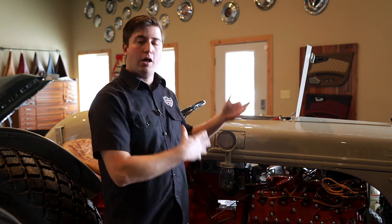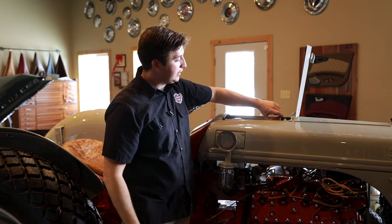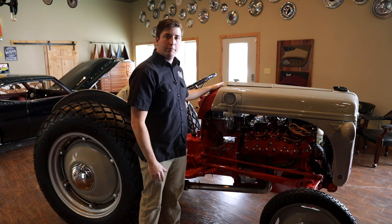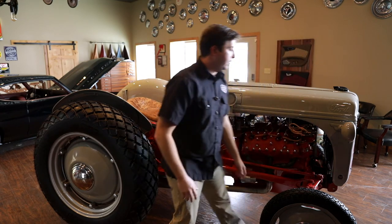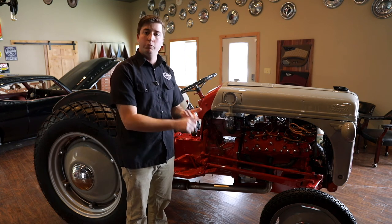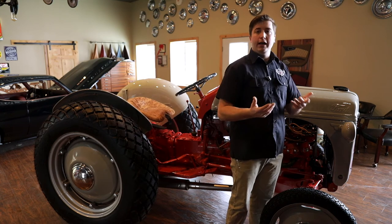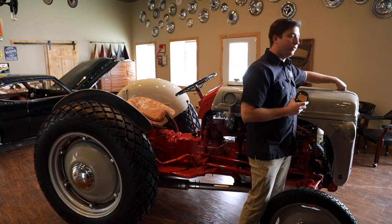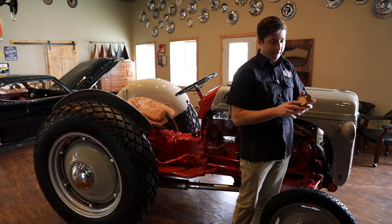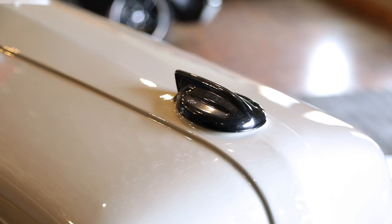Once we got the engine set in, the carburetor actually took up a lot of the space where the original gas tank would have gone, so we have a little bit smaller one up in front, and you can see the air filter sticks out a little bit where the gas tank would have been. For you purists, we have this little extension right here that allowed me to raise the whole hood about four and a half inches, with an extension down here so everything clears. We were able to fit a new aluminum radiator underneath without any issues. The radiator also had its own problem — you can't get the cap back on because the radiator sits down inside the hood. So what we ended up doing was putting magnets underneath the cap so it just sits right on, never moves, and still gives it that factory clean look.